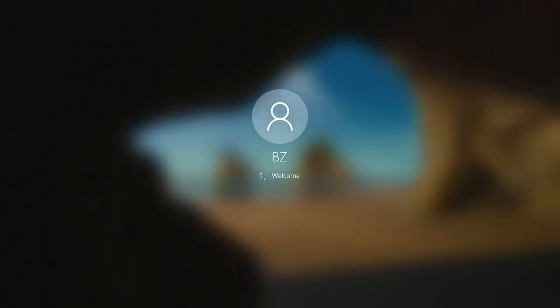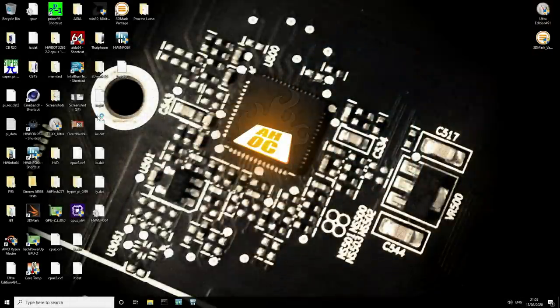And I guess we'll do a baseline run of Cinebench, though funnily enough, Cinebench does not care about memory settings at all. And in some situations, you can actually lose score when, at stock settings, you enable XMP, because XMP eats a little bit into your power budget, and so you lose a little bit of boost, and Cinebench doesn't care about memory, so you basically just lose a couple points doing that. And we're not going to be focusing on memory overclocking today, so Cinebench is just fine.